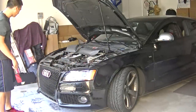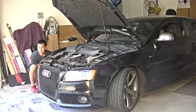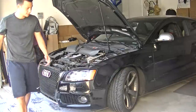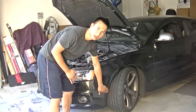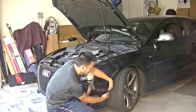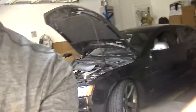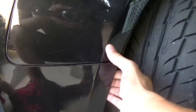So that's in there. Now the fun part. Let's make sure I pulled off the fog light. Okay. So now you'll want to pull the bumper from this side right here where it separates. You kind of just want to pull it out like this — get closer so you can see it and show you what that looks like. So what I'm going to do is right here where it separates, I'm just going to kind of pull it out like this. See? It should easily come out.